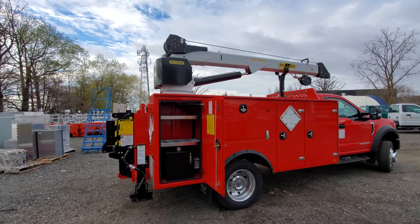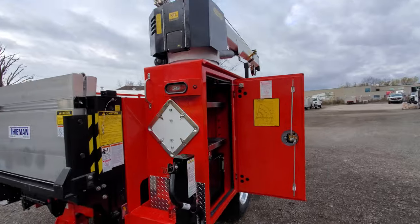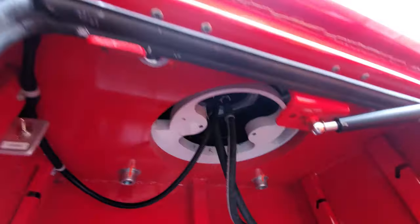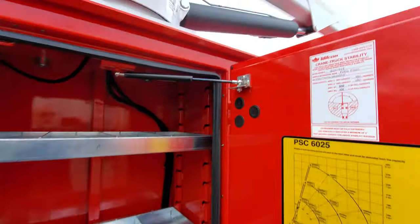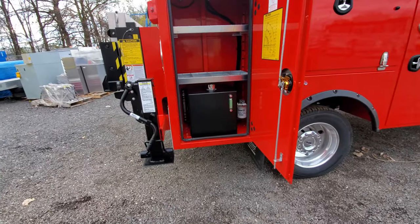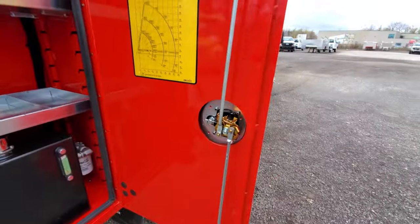This is a steel body — you can tell by a couple of things: the charcoal plate is bolted on at the back and the interiors are painted. The crane compartment has a crane top with gas shocks, standard galvanized shelving with removable dividers, and a tank down below. The doors are still aluminum — doors are always aluminum — with a three-point lock, riveted on.